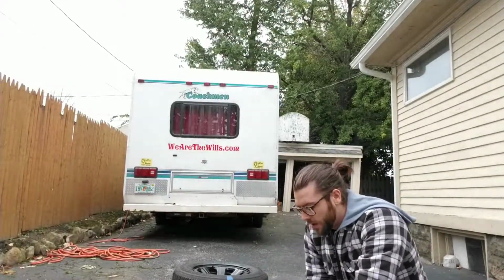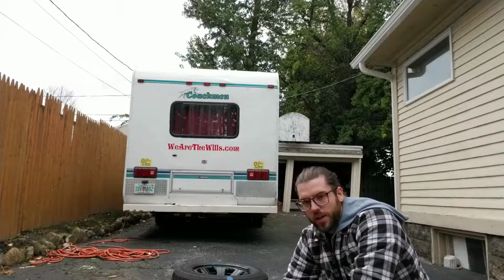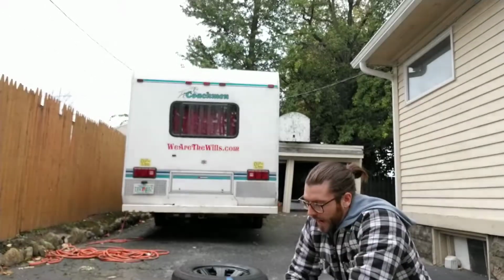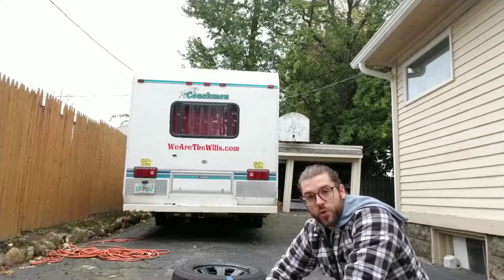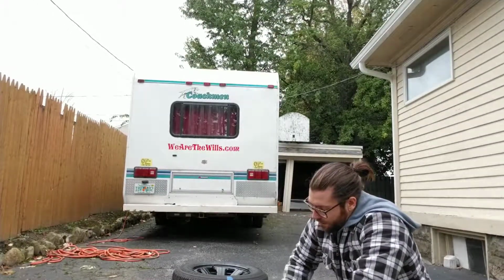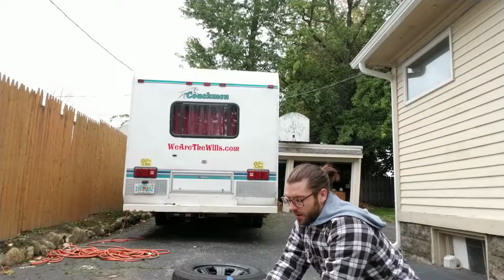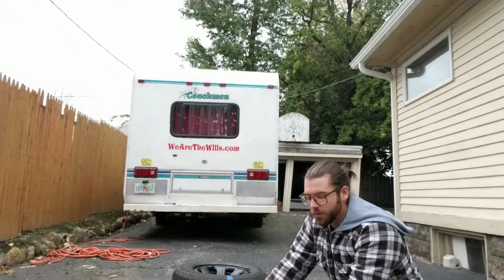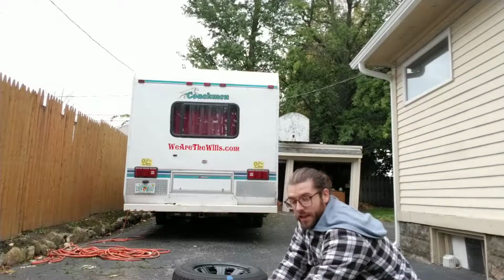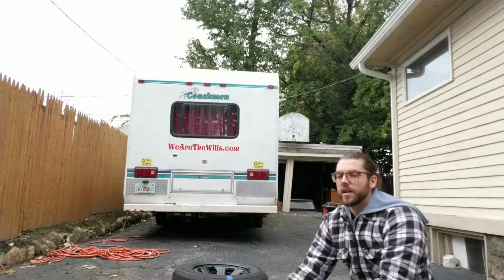Another thing I actually have to do today, which I'll do before putting the tires on, is a few months ago I put new front calipers and brake pads, and for some reason I couldn't get the anti-shake clips or the vibration clips. I could only get them into one of the new calipers with the new brakes. Literally tried for like an hour and a half, would not go in. So anyways, I ended up just putting the clips on one side, and it was fine for a while. But once the brake pads worked themselves into the caliper and kind of carved out a way so that it could be more fluid, they started moving. So now when I'm backing up or I'm first starting my truck up and I'm backing up, and once I press the brake, you can hear it get pushed and hit the side of the rotor.